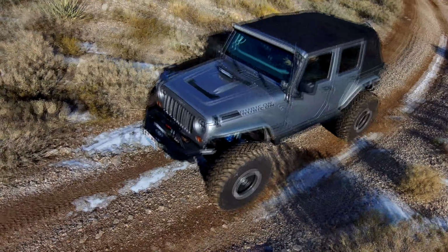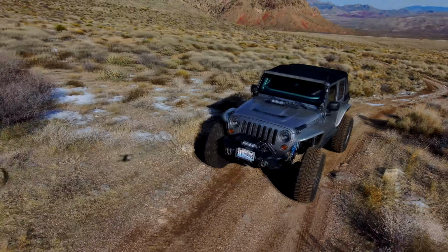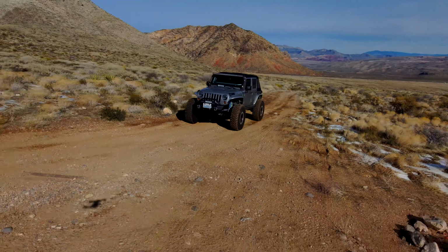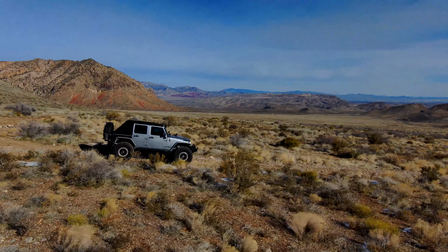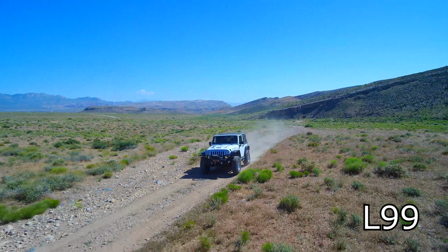I've got one of these in the shop right now. It's an L92 with a blower on it, pushing over 600 horsepower. We've cammed L94s and L99s, and the nice thing about them is you can limit the cam phasing so that the valves don't hit the pistons, and then have a smoother idle, but still have good top-end power equal or better than a LS3.